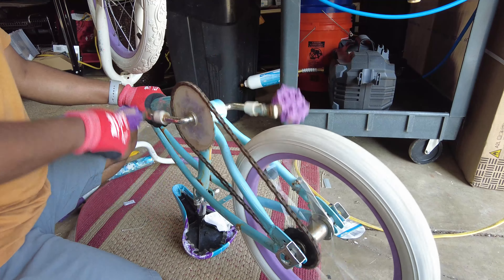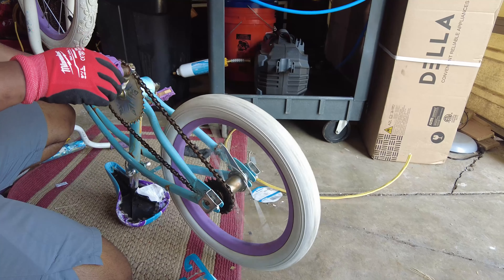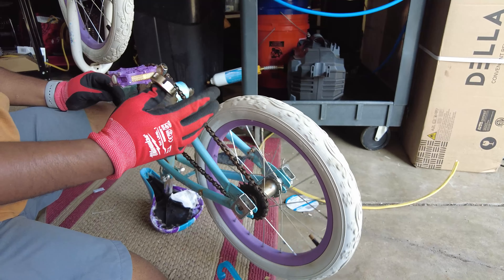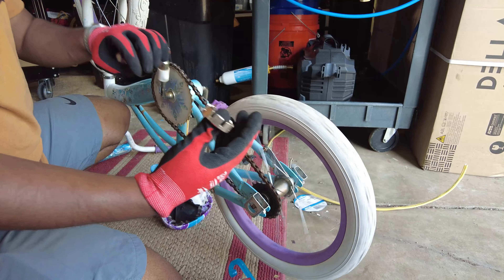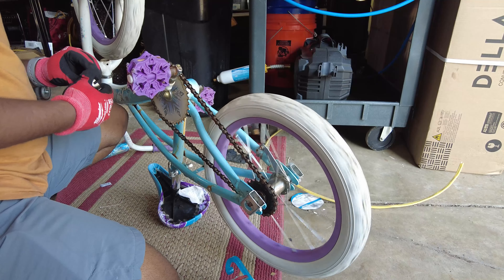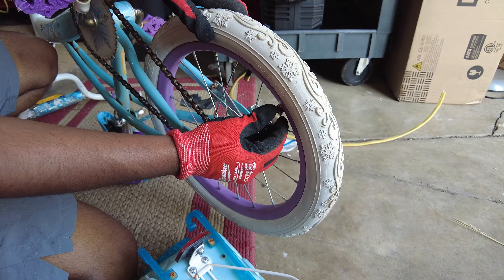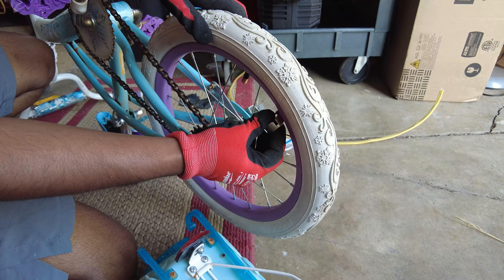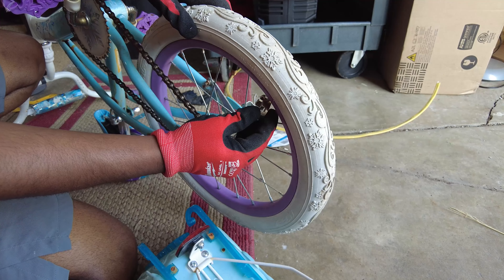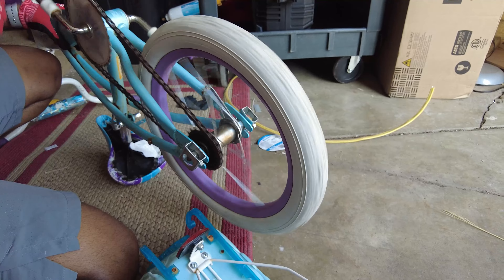I think we're good to go — I'm just going to run it a little bit. As you can see, the wheel is also not perfect — it's out of true a little bit, so we can also tune this up. There's actually a tool for that. You basically find the gauge for the spoke size — it's only going to fit in one of them — and then whichever fits, you tighten or loosen it until the wheel becomes straight. For example, see, now it doesn't move — you can turn it left or right and keep spinning until the entire wheel becomes straight. That's how you use that thing. But this bike is honestly ready to go and we will stop the work here.